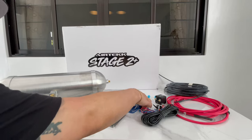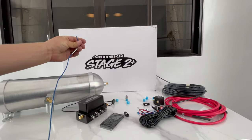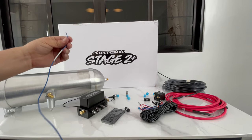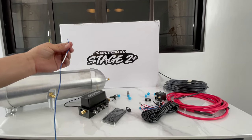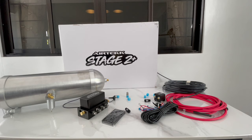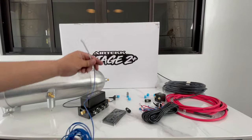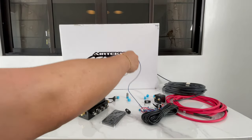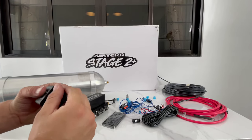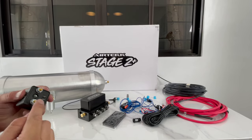You're going to have your ignition wiring harness — this will go to an ignition source, meaning you're going to go to a fuse. Use a fuse outlet around 20 to 30 amps — don't do anything too small because it's just not enough. This will go to the front and then roll back to your relay. I'll show you a little later in the install where it goes. The four gauge wire right here goes straight to the battery.